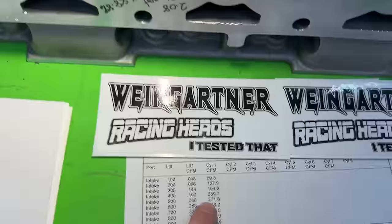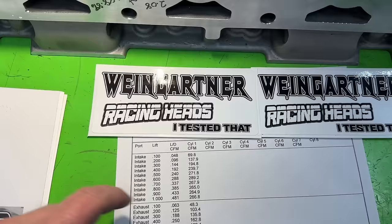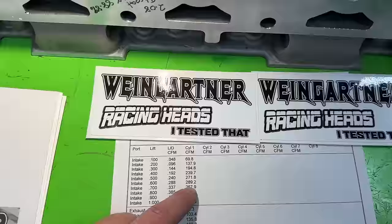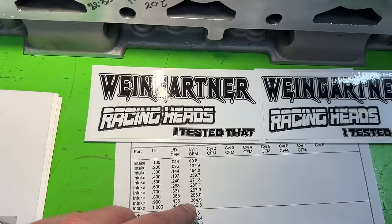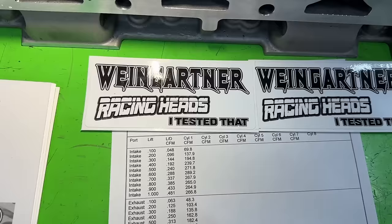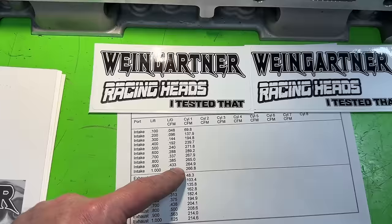However, if this is a smaller RPM deal - you're doing 6,000 RPM - you've nailed it. Don't beat yourself up too much about these. And before someone says, 'well if you're only running a 500 lift cam, what do you care?' - don't say that. Dyno tests from the 496 show that if you make more peak flow, even above where your camshaft is, you make more power. So that's not true either. But you did fine here. If you want to keep pulling harder in the higher RPM range, you need to make the bowl bigger. You also need a bigger push rod pinch, because you will fix this problem so the air doesn't back up, but the push rod pinch is still going to limit you.